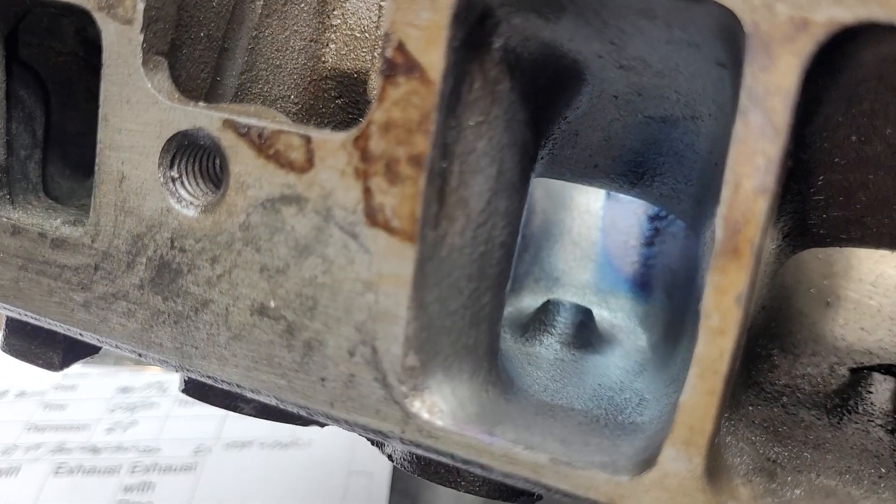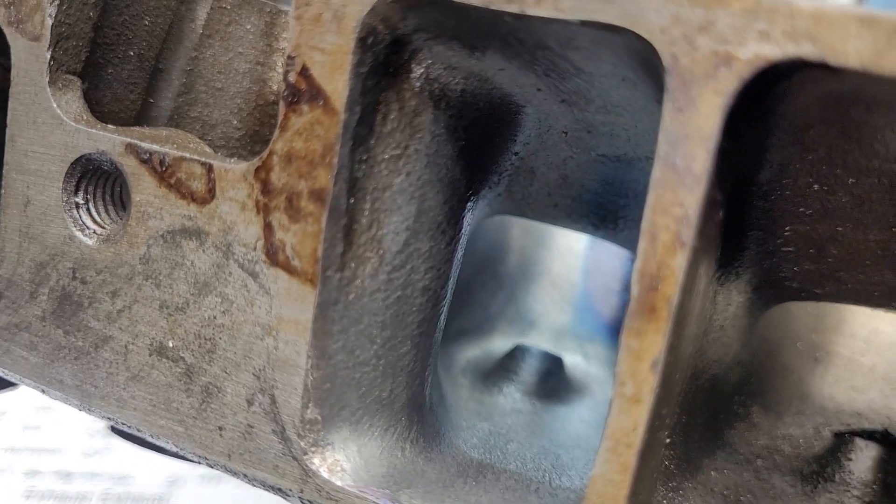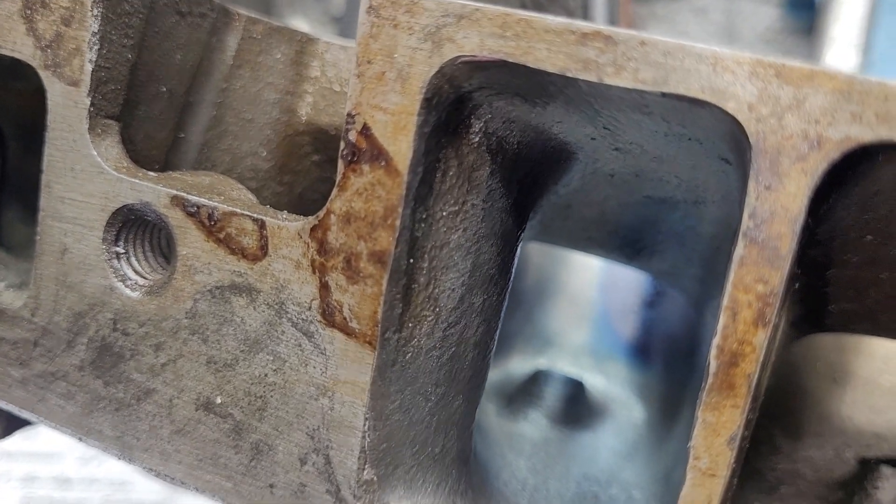Looking right down its throat, you can see we did a good job with the liquid flow. I took out the bolt boss a little bit, but I did not push my luck. I did have to work on the roof — notice it's still got that super aggressive burr on the roof and the walls. Most of the floor and the pinch did get some work. I can't use that super aggressive approach on the pinch because as it gets thin, it'll hammer its way through. You can see it's got a rougher but lighter touch than the floor and the roof.